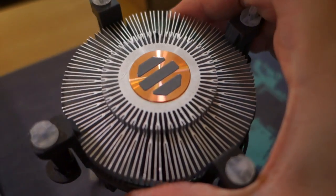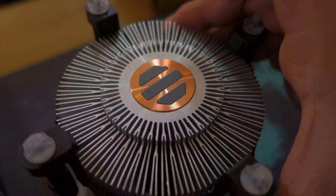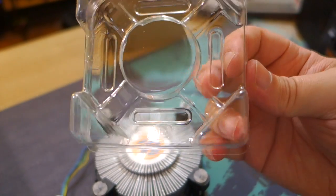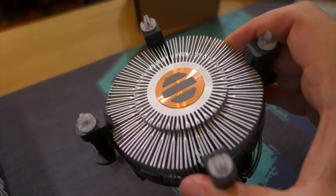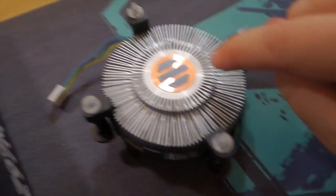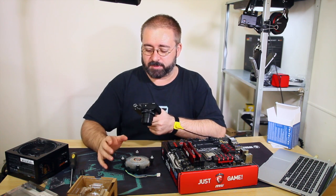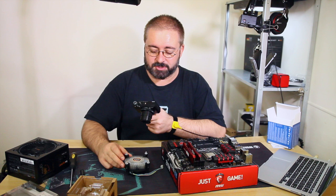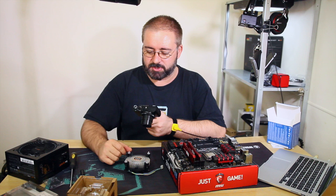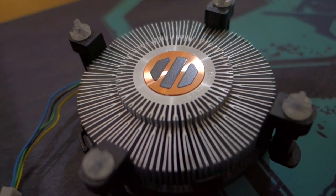That grey compound is not a solid piece of material - it's a goo basically printed into place. That's why it was important to keep it covered so nothing mushed the goo into the wrong place. As soon as it makes contact with the CPU it will start spreading out. Thermal compound facilitates heat transfer between the copper plate on the cooler and the silver plate on the CPU. You don't need very much - it's not there to be a sandwich. It's just there to fill in the tiny micro-gaps, scratches, and air gaps, so use very, very little.